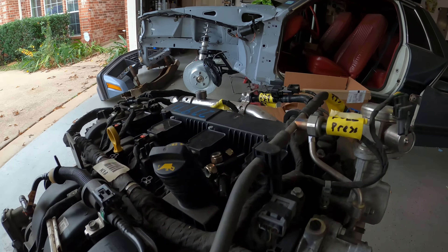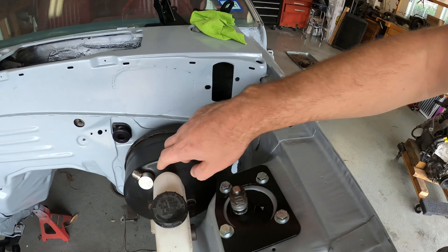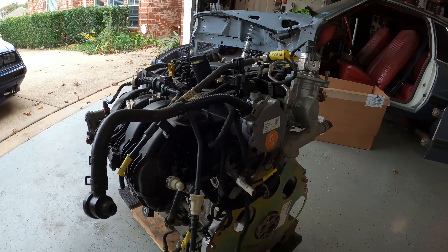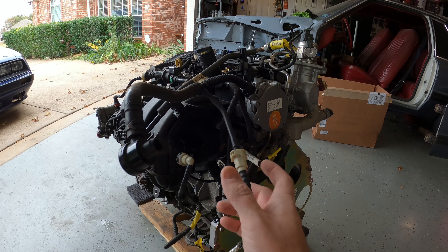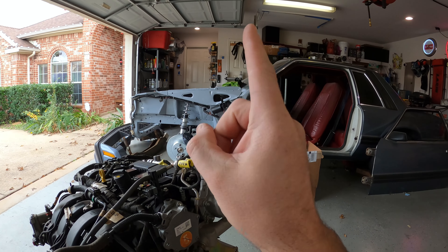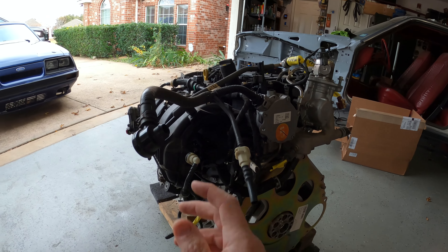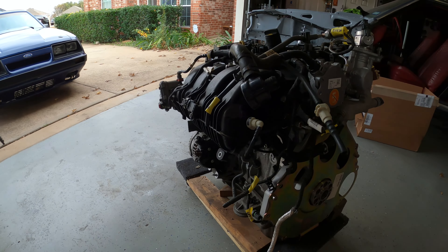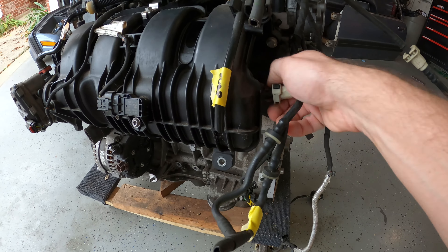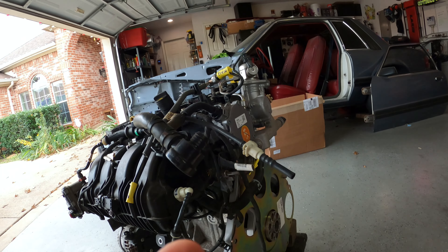The cam-driven mechanical vacuum pump supplies vacuum to the brake booster - I'm running a standard vacuum brake master cylinder, so this feeds right into the booster. There's a second vacuum port that will feed the vacuum canister on the firewall for interior and AC controls. If I ever want to run a manual boost gauge, I'll cap one port and run a separate gauge off the manifold.